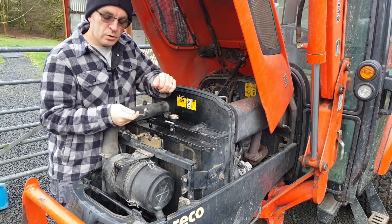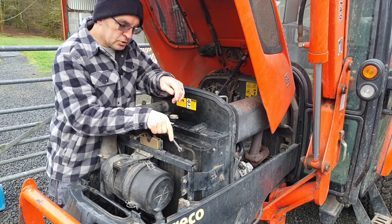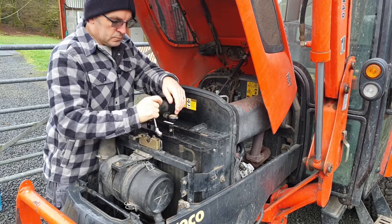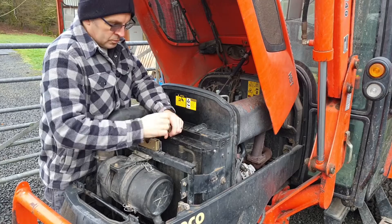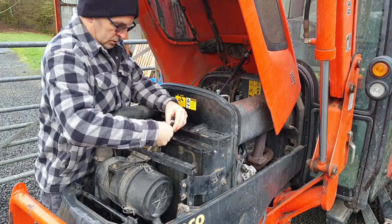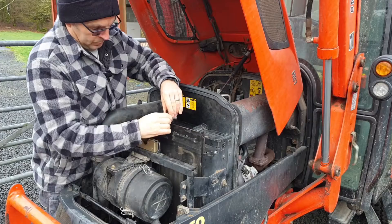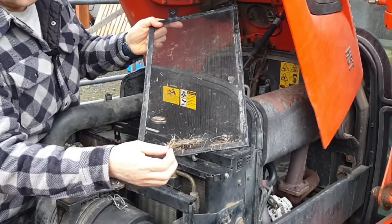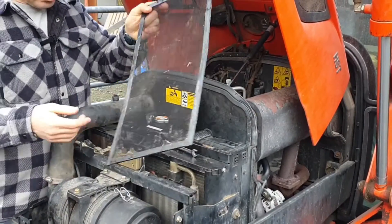The tractor's getting hot, especially if you do a lot of grass cutting, which is mainly what I use it for. It could be as simple as this grill getting blocked. The idea is this comes out so you can clean it basically, but it doesn't stop everything going through. You can take it out — it's really simple to knock the dust out of it.